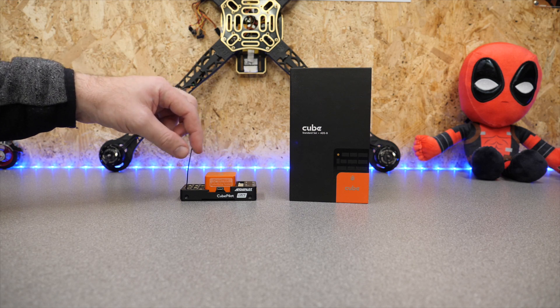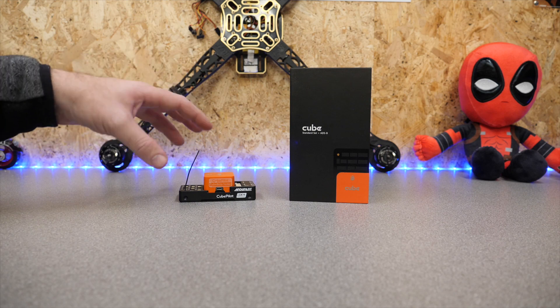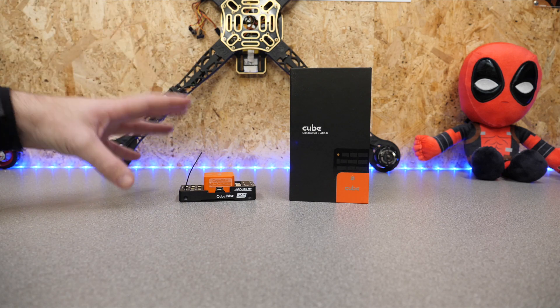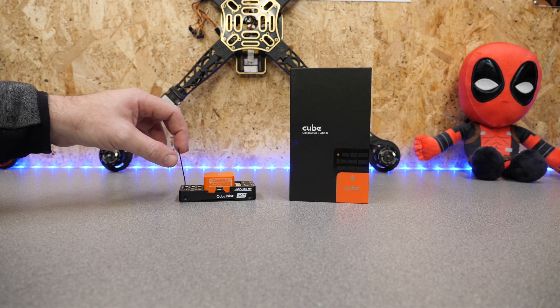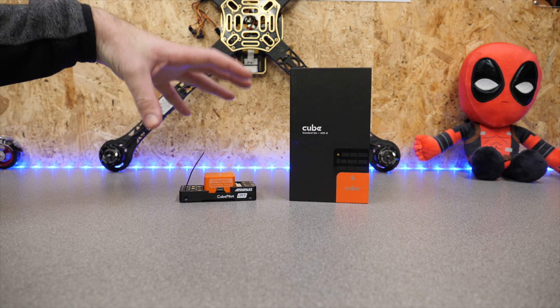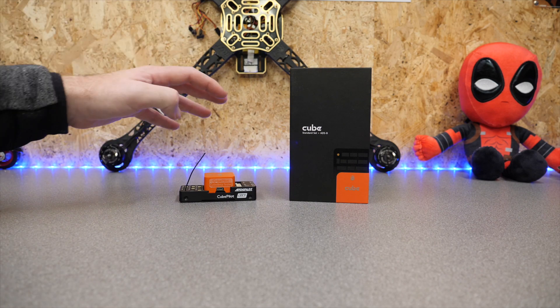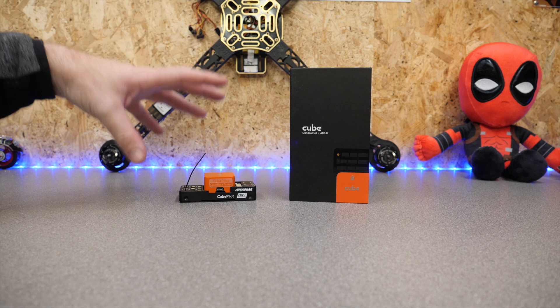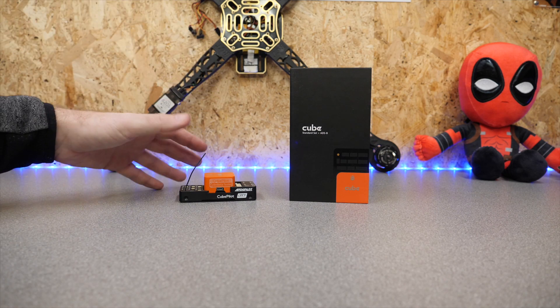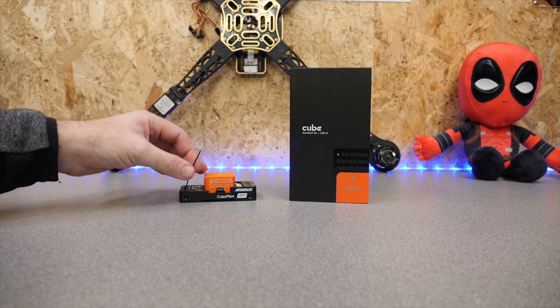If you didn't want to do that modification, I'm going to talk about a couple of requirements for making sure you're getting the best signal. If you are going to use this with the built-in antenna, you want to make sure you are not covering the autopilot with any carbon. If you're going to use a canopy it needs to be a plastic one and not a carbon or metal one, because the ADS-B antenna won't be able to pick up the signal.